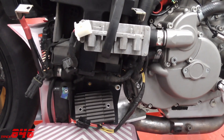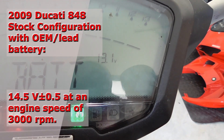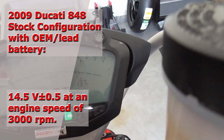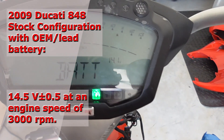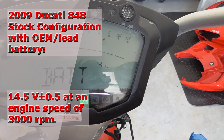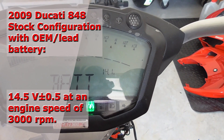So I'm going to reinstall this and the ECU, and then we'll basically be finished. We can crank this up and see where we're at — we have 13.1 volts. Let's go ahead and crank it up. We should see a steady climb up into the 14s. The specs on this bike call for 14.5 volts DC plus or minus 0.5 of a volt, and you can see that's pretty much what I have here. This looks good.